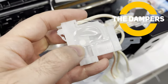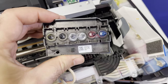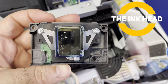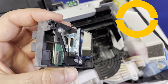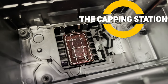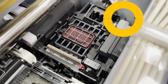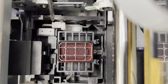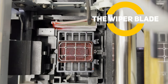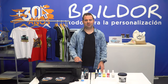The Dampers are the cartridges located above the printhead and are connected to the EcoTank through a tube. The Printhead is the component that helps transfer ink and needs to be looked after — we'll explain how to clean it and replace it when needed. The Capping Station is where the printhead rests and flushes the waste ink, keeping the head in good condition. The Wiper Blade is a rubber blade that cleans the head when it comes out of the capping station.